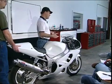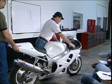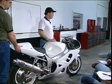Now same thing again, you can get a better comprehension of your suspension if you'll feel it in the top, feel kind of what the low speed rebound is doing. This is more what your adjuster's doing, but then when you really bury it, you're looking at what's the valving doing, what's the shim stack doing, okay?